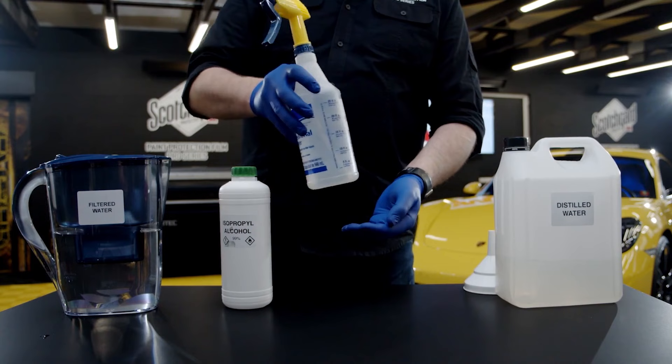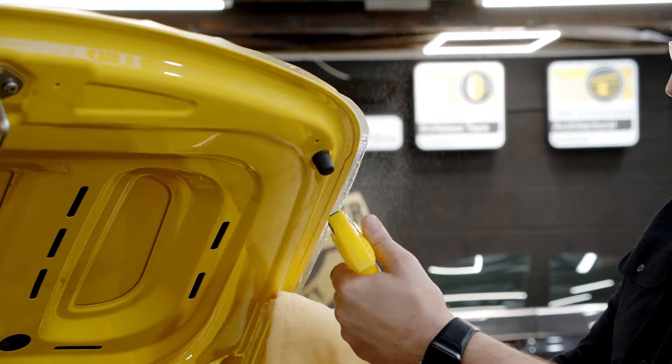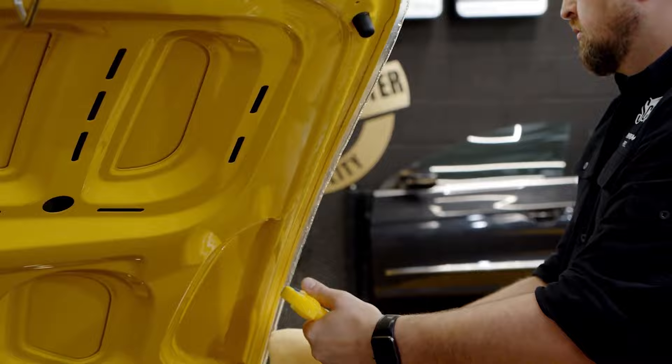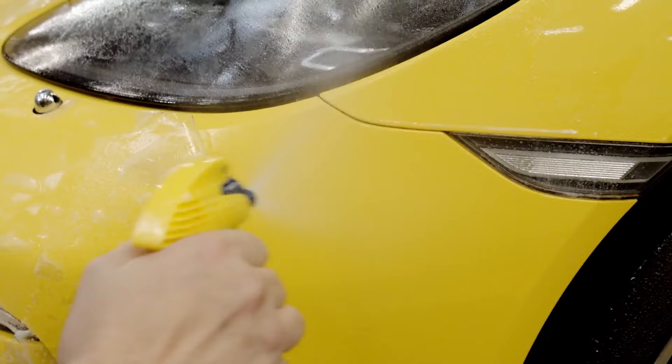Here are the examples for Tack Solution. Flushing out the soap with Tack Solution speeds up wrapping the film around the edges and locking the film into position. When installing pre-cut patterns, Tack Solution is used to lock the film down at your registration points and help seal out the edges. Remember, 17% isopropyl alcohol by volume must not be exceeded in any case.